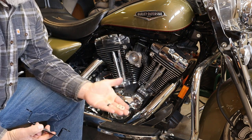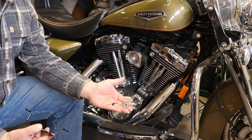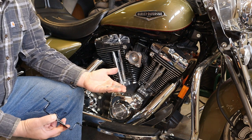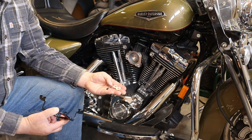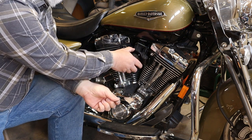In my case there's a little space — the arms aren't resting flush. DK Customs says to just find a couple of washers of the right thickness to fill in that gap. Most people have a lot of washers laying around, so just find a couple that work to take up that gap.